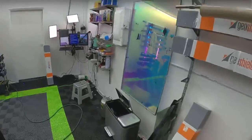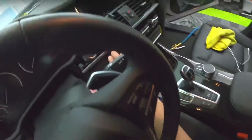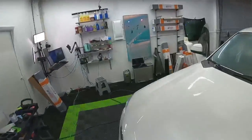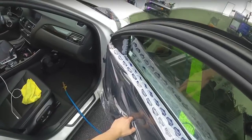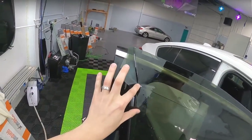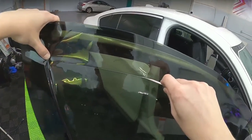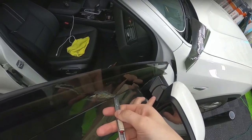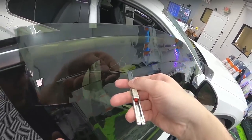Harder double cutting on darker film — I guess if you're trying to see, that makes sense. But for hand cutting, so much of it is just by feel. I did a video where I installed a window blindfolded. I can see the top edge up here, but one thing I'm doing before I make my cut is pressing right here — I can tell exactly where that edge is, then go a little bit above that to start the cut. Same thing with the side seal — you press the film up against it and ride that seal straight down. It's not by sight, it's by feel.